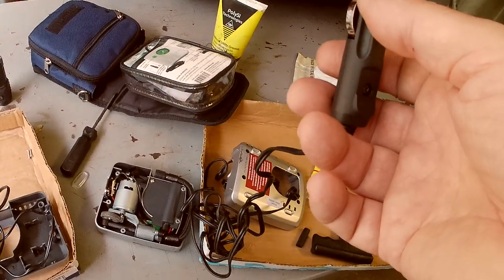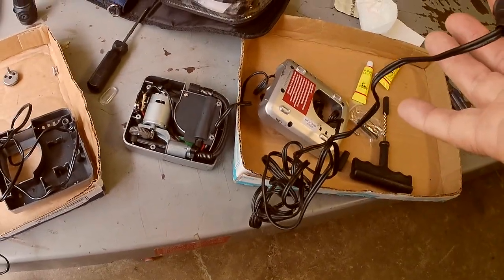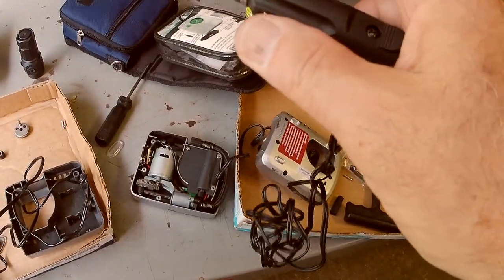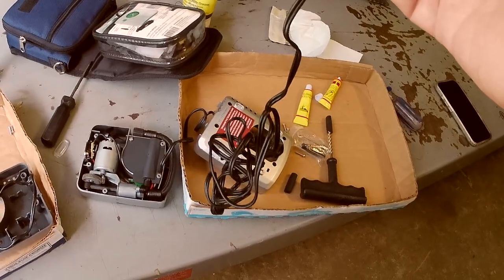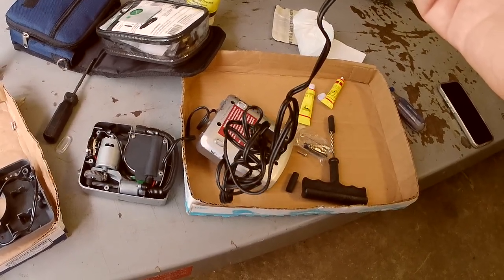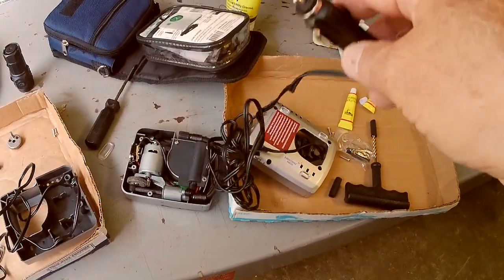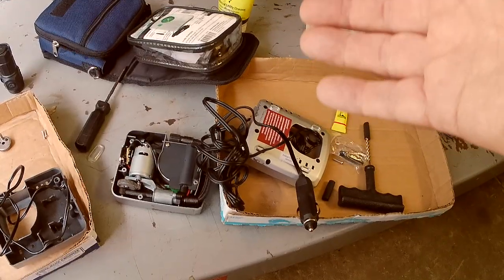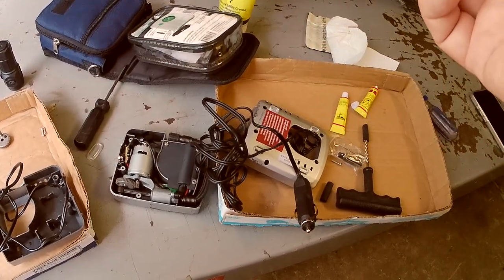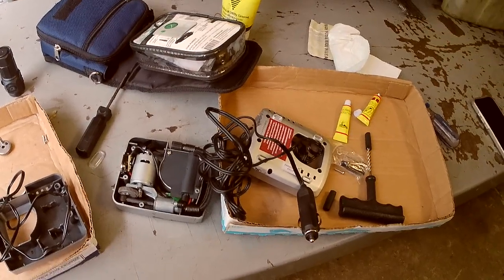The fuse isn't going to blow, and what are you protecting? You're protecting the pump. You're not protecting your motorcycle or your car. The fuse is to protect the wire. But it's probably not going to burn up. You know, it doesn't pull that many amps. And what do you care? You want to get going. You're only going to be running it for about 10 minutes maximum with a motorcycle to pump up the tire.